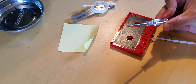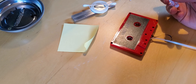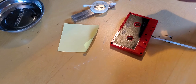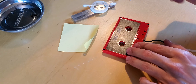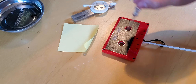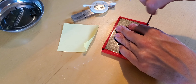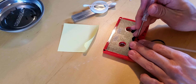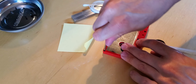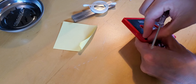With your screwdriver, you're going to want to avoid using a magnetic screwdriver, because you're working with magnetic tape and you don't want magnets near it. If you can't avoid it, I only have this magnetic screwdriver, so I'm going against my own advice. Also, use a screwdriver that's properly sized for the screws so you don't strip them. This cassette is by the artist Ghostlight — I've listened to it, it's a good tape, kind of minimal wave, synth wave stuff. We're going to open it up by removing these five screws.